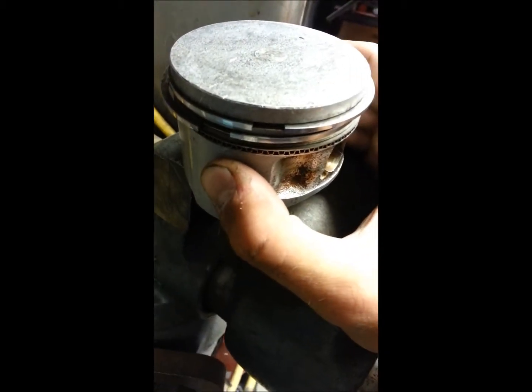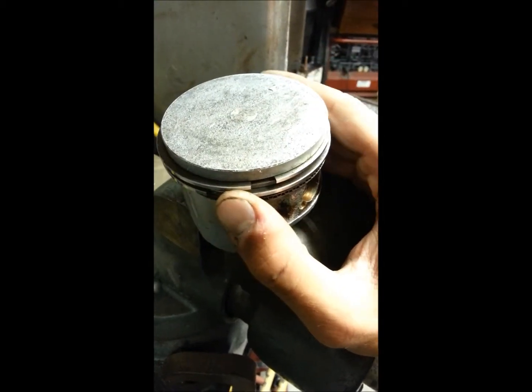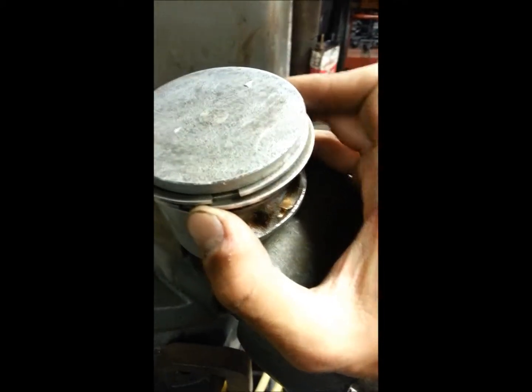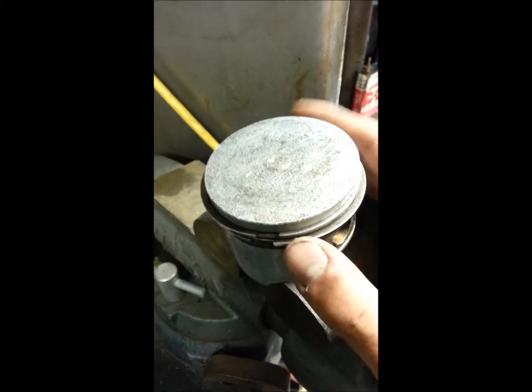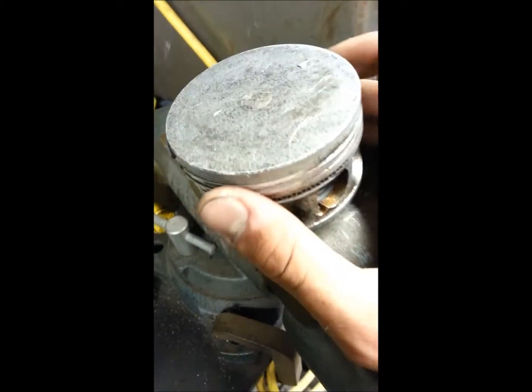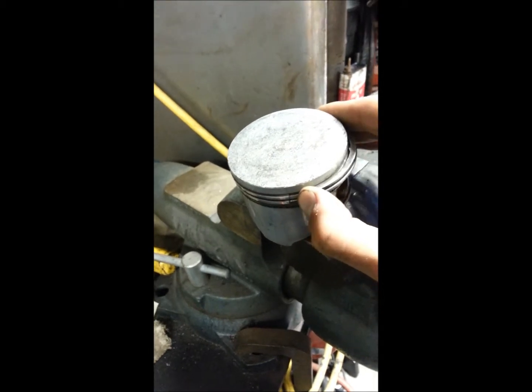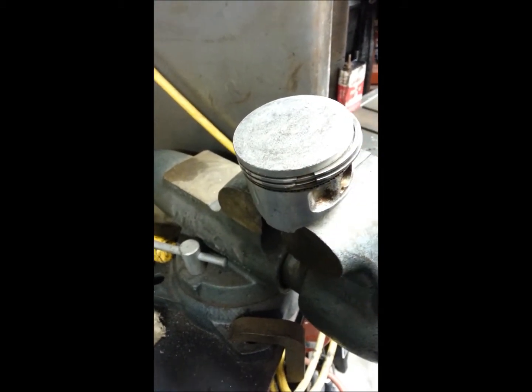Your oiling rings are a little less brittle, but your compression rings are usually very brittle — they're not designed to really bend a whole lot, so you have to be careful. Just pay attention to your markings, and usually they'll come with instructions. If you read them and follow them carefully, you'll be just fine.